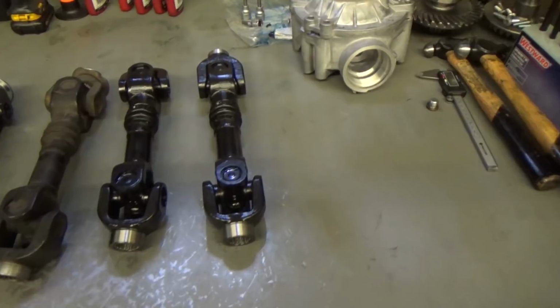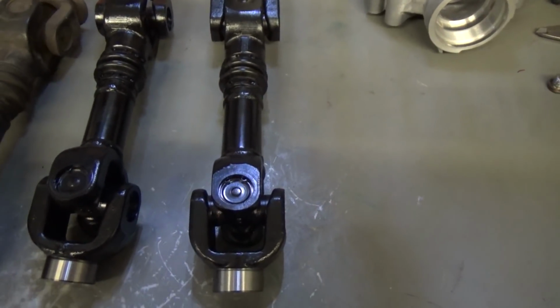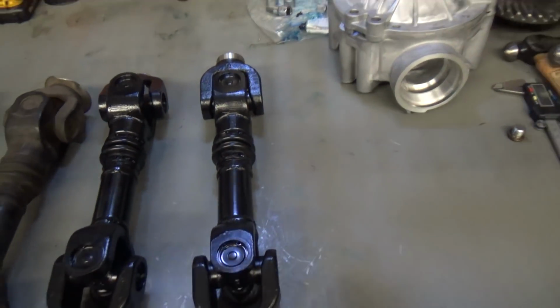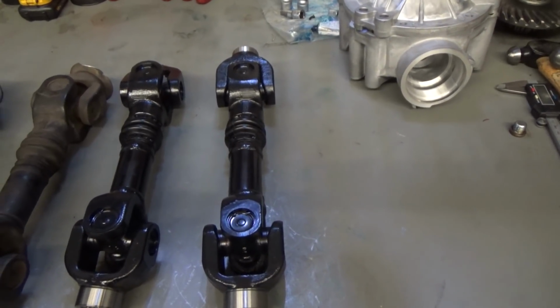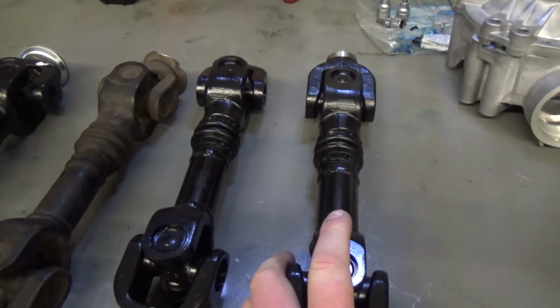First of all, most of you guys, if you watch my other videos, you know what prop shaft phasing is. It's when you want this yoke and this yoke to be both perfectly lined up in its 12 o'clock position. And at first glance you'd think, yep, that looks pretty good. Now on second inspection, just do a quick little test here.